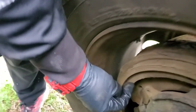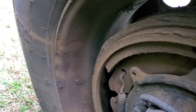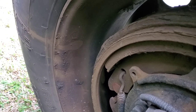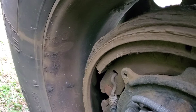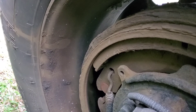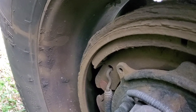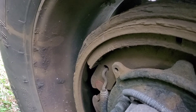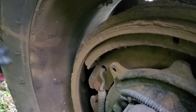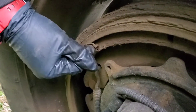There should be a small little gap now. I'm going to release my brakes and make sure that this gap here — if you can zoom in — this gap should open when the brakes are released. You can see a slight gap right there, that's what we need. We don't want them rubbing when we're driving because this will heat up and it'll catch fire.